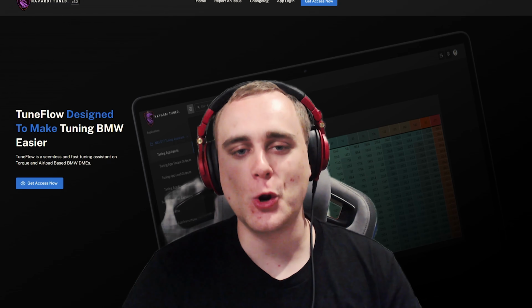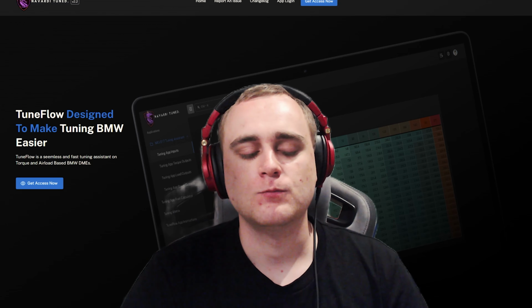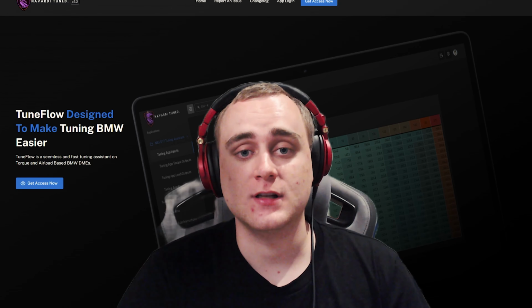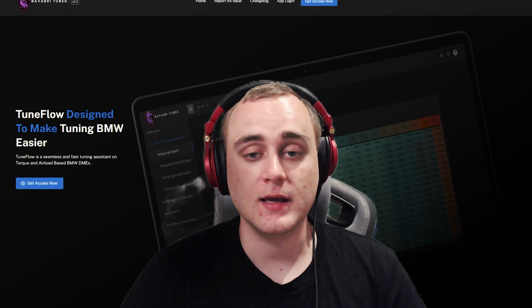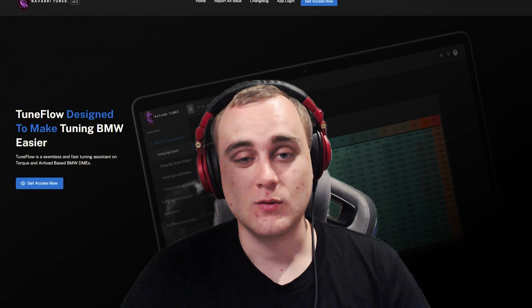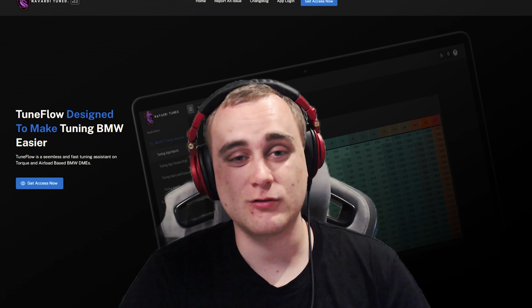No one in the world has Darton wet sleeves in an N20. The world record N20, for reference, has Darton flange sleeves. It is open deck. It is making a lot of power. Now, why hasn't that failed? Well, I'll give you a few examples. One, they were correctly designed flange sleeves. Two, we're not running a lot of boost.